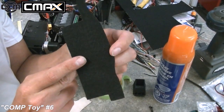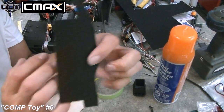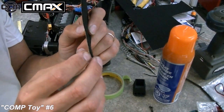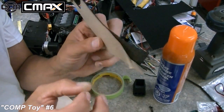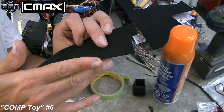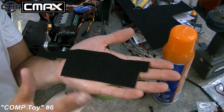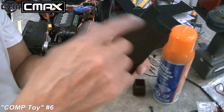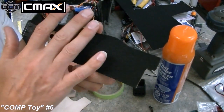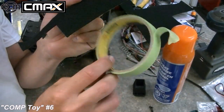So I've painted these in all kinds of different colors. The Bronco, the Ascender Bronco that we have, the Bandit Bronco, it's got a full blue carpet in it, but it was actually black foam, or black polyethylene mat, with the sticker on the back. We lined the whole thing with the backing on it so we could cut it out to shape first, and you can put it in the truck with the backing still on it so it's not sticky. Cut out all the shapes, it works perfect, lay it all down, and then you just bring this to the paint booth. We painted the black with about 5 coats of the dark blue color, and it gave us this perfect blue carpet. So it's pretty cool. You can paint it. It looks fantastic. If you need to hold it down, use this.